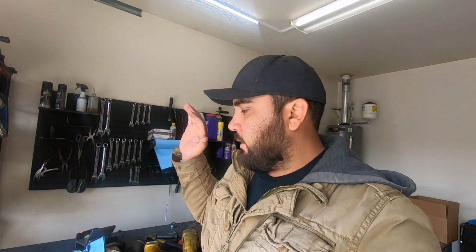Now, like I said, that's hopefully the plan for today's video. But the first thing I've got to do is diagnose a problem that the truck is having. I'm having a low fuel pressure problem, and hopefully it's as simple as the truck being low on fuel. It happens to all of us. I let it go under a quarter tank, probably under an eighth of a tank, and I'm hoping that's the only problem this thing has, that it's low on fuel.